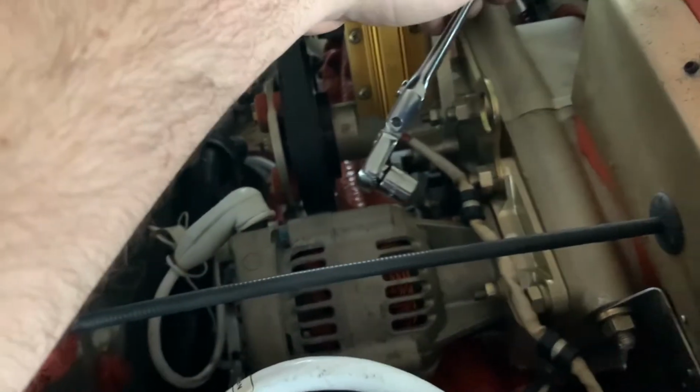Now most of these I got with a wrench, but this one, because this idle clamp gets installed over it, can't use a ratcheting wrench, can't really use a regular wrench because this is in the way. But the pass-through socket will get down over that bolt and then go in so you can tighten it.